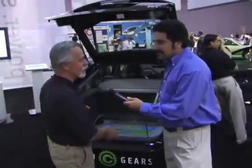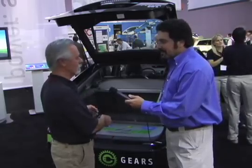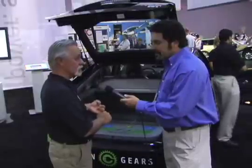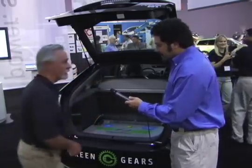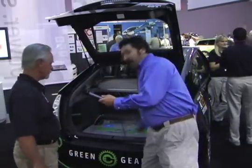It's a little deceptive because you've got a box here that's all closed in — you can't see how complicated it is. Obviously the things inside this box are extremely complicated. You have a series of lithium phosphate batteries from A123, a battery charger which is a smart charger — very different than the average charger. You have a battery management system to keep control and balance all the batteries, a computer which interfaces with the Toyota computer, and a plug. It's all in one box.